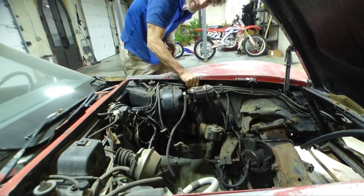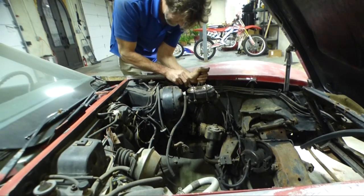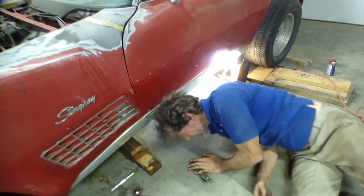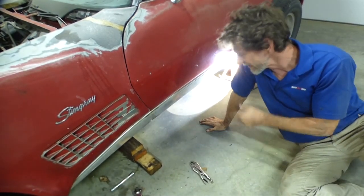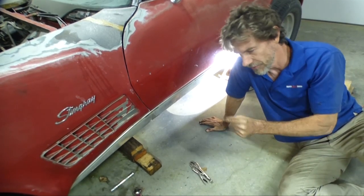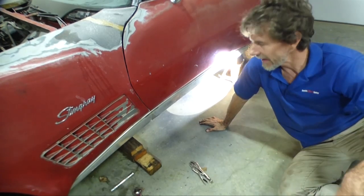And the parking brake. I need to do the parking brake as well. Alright. Okay, so the parking brake is disconnected. I just unscrewed the adjuster tab. There's a little pulley wheel that I removed to slide the cable through, so the parking brake cable should come up for the body now.